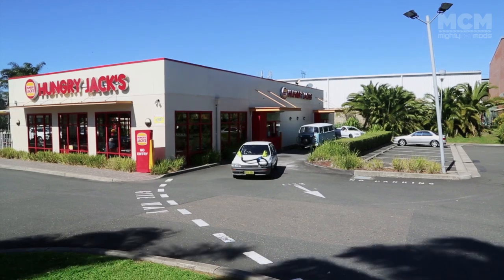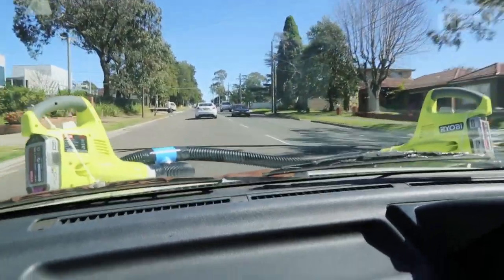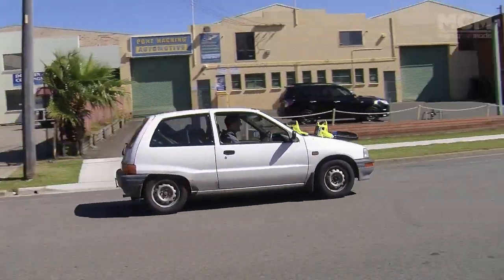and take huge amounts of exhaust energy in the form of heat and pressure, and there's no way that this eBay fan delivers that kind of performance. Moving air doesn't take much energy at all, but to actually compress it and create boost pressure, you need a lot of energy, more than any cheap fan is going to be able to supply.